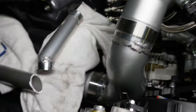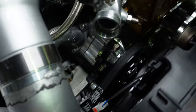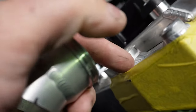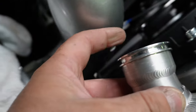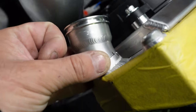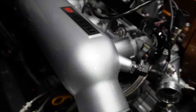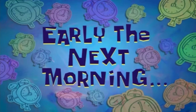I need to talk to the tuners to make sure one fan will work, but I'm pretty sure we can make it happen and it'll also clear up the area and make it easier for changing belts. As for how bad this radiator situation has been - the top radiator hose: I told them this was an RB26 30 setup so the outlet was going to be a little bit higher, but this was pointing down. We had to cut that beautiful weld off and rotate it slightly so it's facing up. Even then it's so close to going into the intake manifold - but I understand that Hypertune radiators are designed for cars running Hypertune manifolds, so I'll let them off for that.